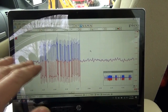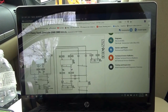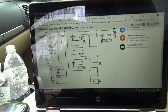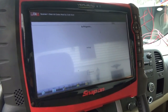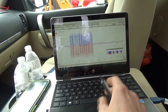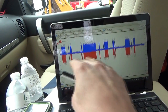Let's do another full code scan — our network is looking great. Even without that terminating resistor it's kind of fuzzy, but at least now we know the problem is somewhere from the EBCM through the trailer brake control module to that data link resistor. So we've eliminated most of the network and we're almost done. The scope is showing a clean signal: 2.5V bias up to 3.5V and down to 1.5V.